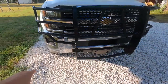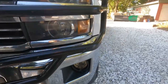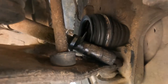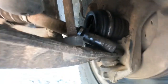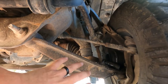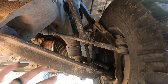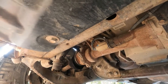Some damage points that we'll need to be fixed. We've got our fog lights up here — this one has been broken, so we'll be doing a repair on that. Underneath in my initial inspection, I found this, which looks like it's not been installed for a very long time. I think this might have a leveling kit on it. Usually that causes some CV shaft wear, so I will need to be putting new half shafts up front. On the other side we've got a broken boot, so it needs two new half shafts up front.